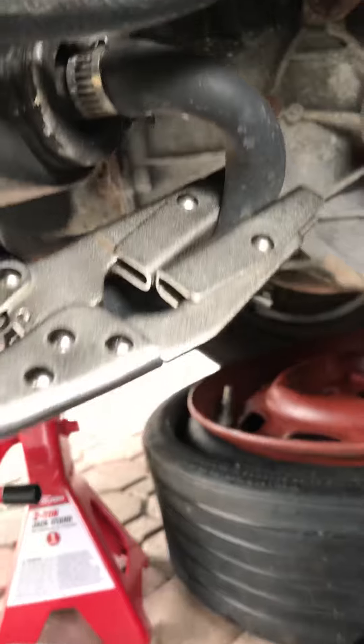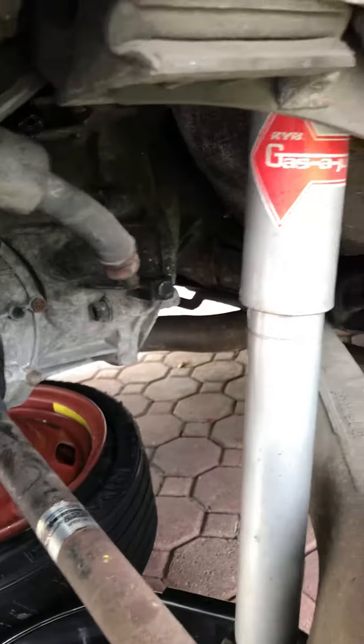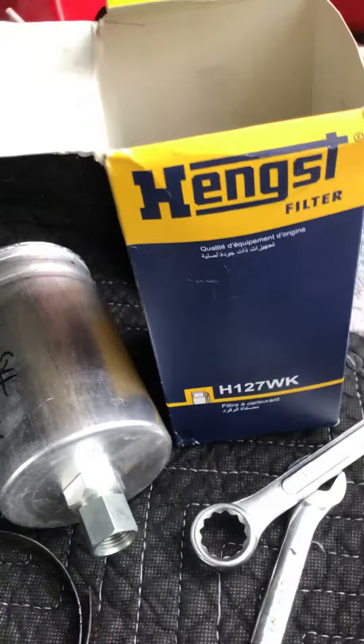Get your car jacked up, pinch off the main line coming off the gas tank so nothing comes through, and get yourself supported at multiple locations. Always throw tires under the car just for peace of mind, and get a support under the back as well. Use common sense safety — no electric lights — and be careful, there's a fire hazard.